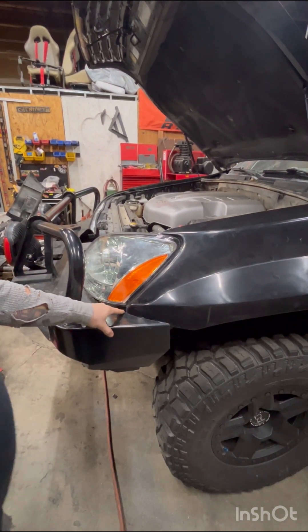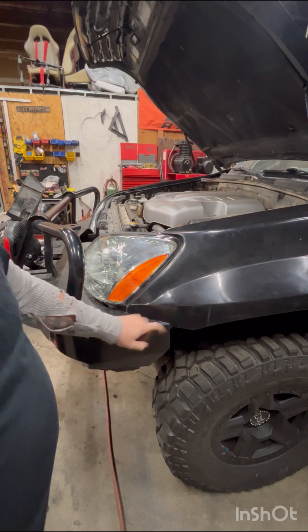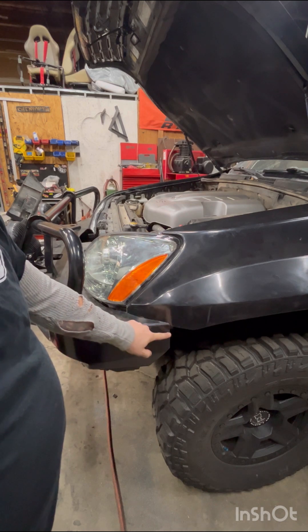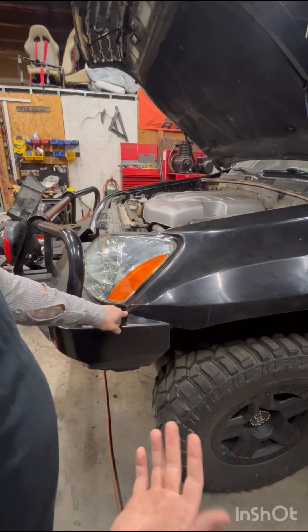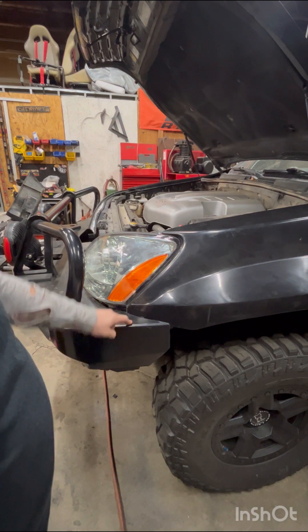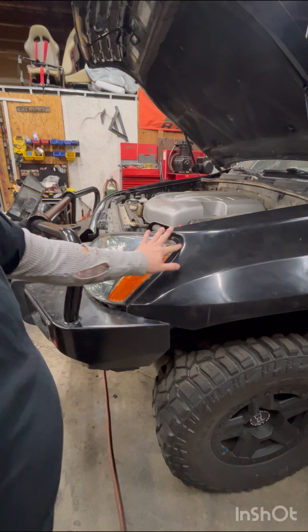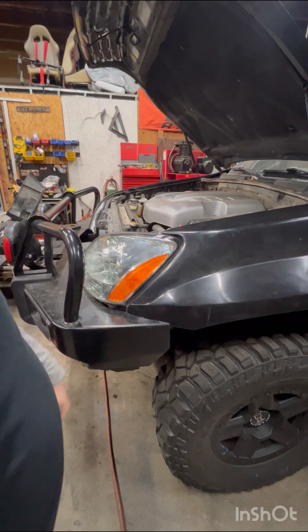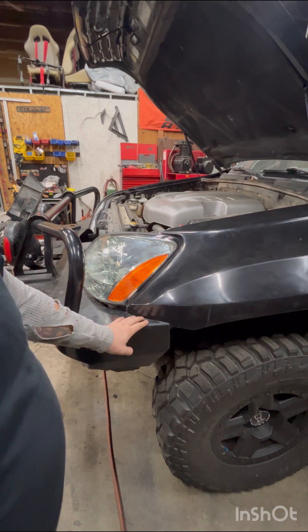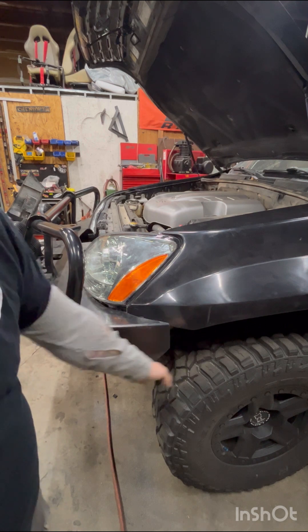This is the piece that I had to do a lot of grinding on to get this bumper to fit the fender flare. As you can see, this is how high it is right here going down. You'll notice a difference on the other side — that's not really my fault, that's just the bumper. This all looks really well though and we want to keep it looking like that. So that's what we did for this side — not too bad. Just cut it back, gave us more wheel clearance anyway.